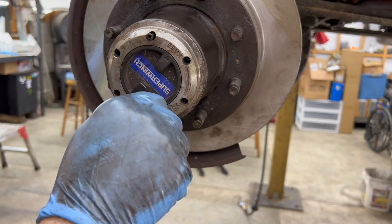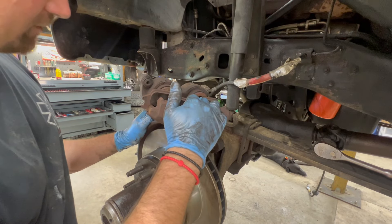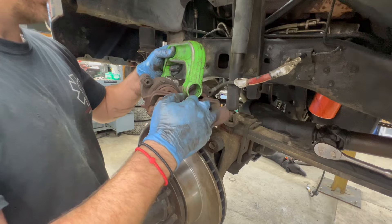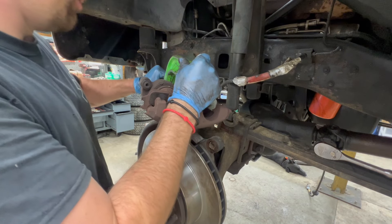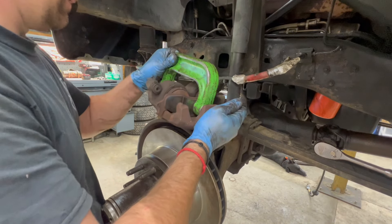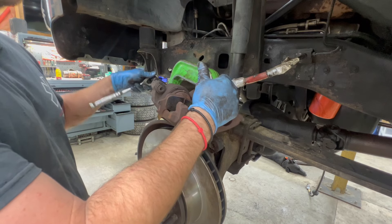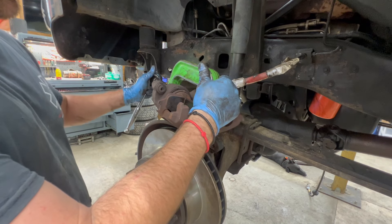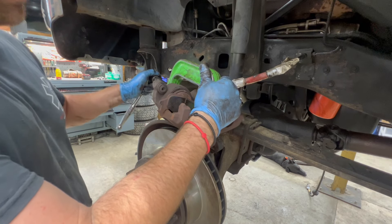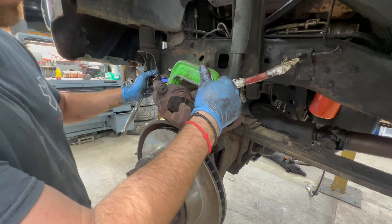Now we're going to catch up on our brakes — I've got to push the caliper in, put our new pads and springs in, clean our sliders. Always just use the old brake pad to push the caliper back in. Make sure you've allowed room for your fluid to get pushed back to the reservoir and that the cap is off. I use my ball joint press — before anyone gets bent out of shape, it doesn't take that much force and I can actually turn this with my hand, it just makes it easier to go nice and steady without blowing any seals out on the caliper pistons. Then we're going to pull our sliders out, clean them up, grease them, put them back in, then we can mount the bracket with our new brake pads and springs and slide the caliper on, and then we'll be good to go — new bearings, new brakes, and new rotors.